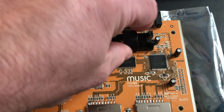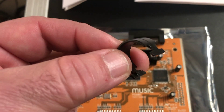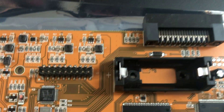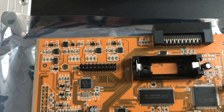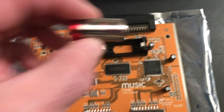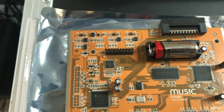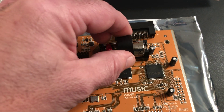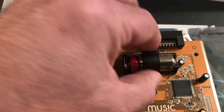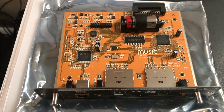There's a little collar on the board that you've got to pop off. I got the hold-down collar off - that's what's going to keep the battery in place. You'll see there's a plus sign right there, so we're going to put the plus side of the battery - the nipple side - right in there. Make sure it's all the way down. Now the battery's in. We're going to put the clip back on. You can hear it snap and it's in there secure and ready to go. We've got the board ready to be installed with the battery backup in it.